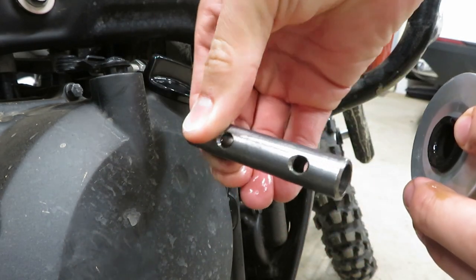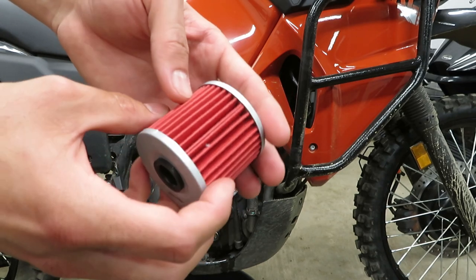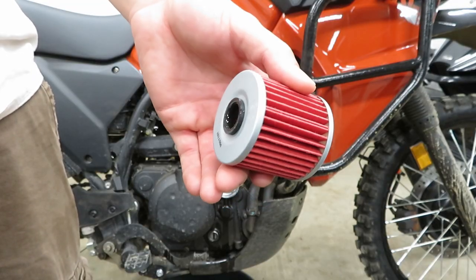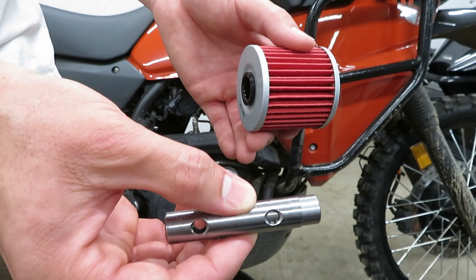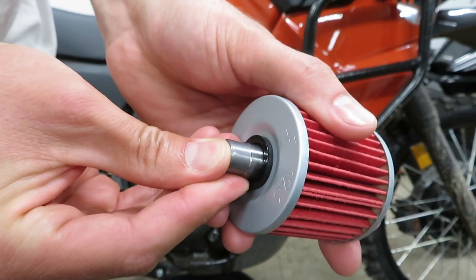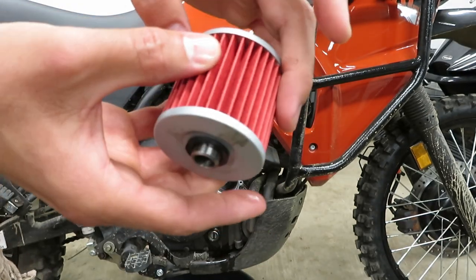Insert the sleeve into the new filter. There's still a bit of debris in the housing, so I'll stick a paper towel in there to clean it out. Give the new filter a once-over for manufacturing imperfections, then lubricate the gaskets on both sides with a little oil. Orientation is very important — the manual says if you get it in the wrong way you will seize your engine. Go large diameter first, push through until the shoulder disappears into the gasket, with the smaller diameter stub sticking out towards you.